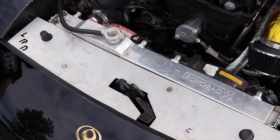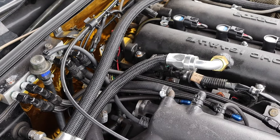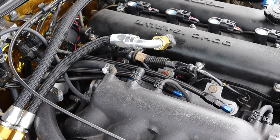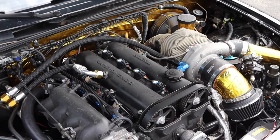And what do we have for cooling? I've got just about everything you can do for a 1.8. It's got a 55 millimeter — the thickest radiator they have. It has the M-tune coolant reroute on it. I'm running factory fans because they push plenty of air, so there's no reason to upgrade if they work. The engine is built as well — it's bored out to 83.5 millimeters, it has Wiseco 8.5 or 9-to-1 compression pistons, Manley H-beam rods, ACL bearings for the mains and rods, and ARP studs for head and mains.